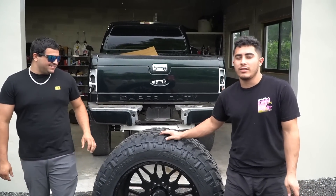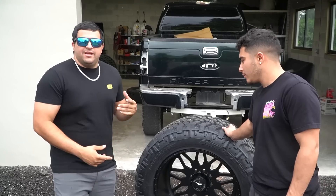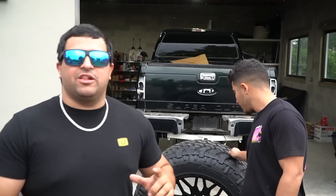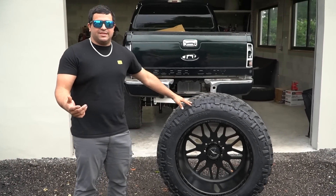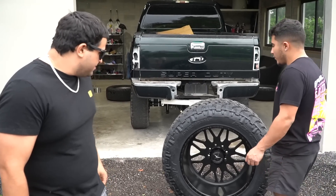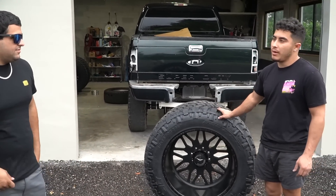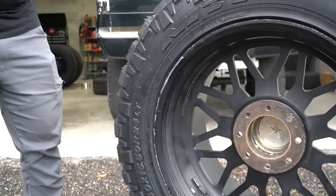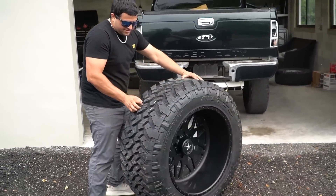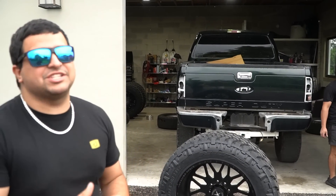We're gonna give you guys a little review on the wheel and tire setup. First of all, they're not Furys. If you guys have been following the channel, a long time ago you remember we made a long drive to Tampa to film a truck of the week — on the way we picked up a set of wheels. We got a set of 24-by-14 American Forces that we picked up in Tampa, powder-coated matte black, with General Grapplers 40 15.50 on 24s. They're just about the best tire you could buy — that's why they cost so much, and they balance out really well.